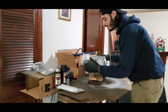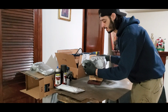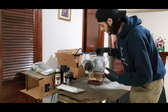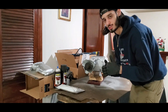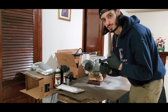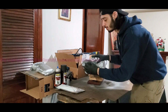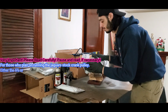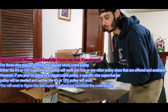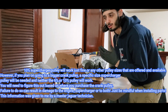All right, you guys, real quick, I just want to point out a couple of things in terms of the supercharger snout and the pulleys. Obviously, I'm not sponsored by anybody, but just speaking on what I saw on eBay from Quality Superchargers, the snout options they offer are a 6%. Let me start from the beginning. They also offer a stock pulley with a rebuilt snout, 6% with a rebuilt snout, and a 10% with a rebuilt snout. Now, if you're going to be doing this job like I am, I would personally go with the 10% pulley. If you have the stock pulley on like I do, might as well do it this way. Obviously, this all depends on your budget and what you want to do with the car in terms of power or goals.